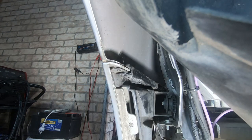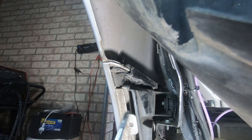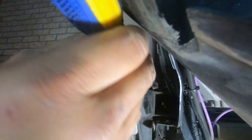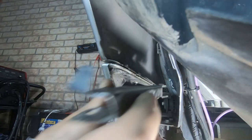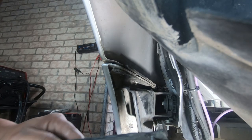T25 Torx screw removed. Now, what you need is a flat head screwdriver or some sort of pry tool. You basically get it in here and then you pry it out. As you can see, I'm prying it out, and then once it gets to a certain point, you can just pry it all the way out. Now, you don't just pull it straight out — it comes out on a 45 degree angle. Get it out to about there and then pull it straight out. That is the bracket removed. In order not to lose your screws, I like to put them back where they belong.